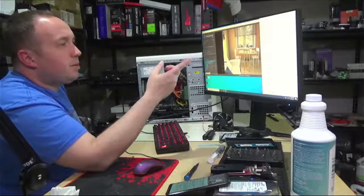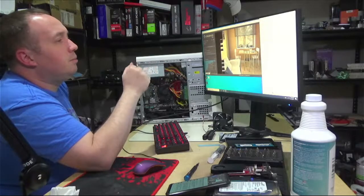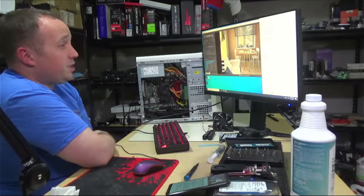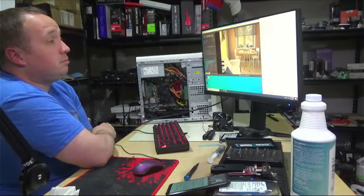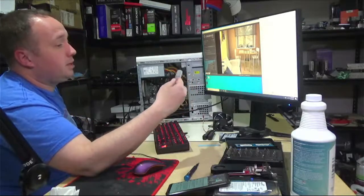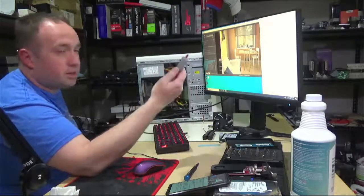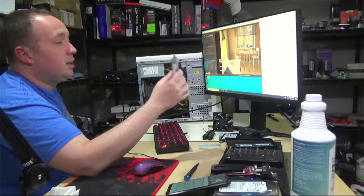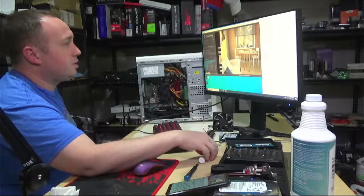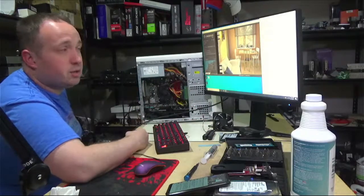So we're at a peak of 72 right now, so that's still 6 degrees below what we got to last time, unless it keeps rising. 6 degrees off max core temp is not anything to sneeze at, just from some cheap thermal paste, like this GD900 stuff from eBay. Since I repaste stuff constantly, CPUs, GPUs, you name it, this stuff is like $9 for this giant syringe. So I got 2 of them for 20 bucks shipped, and it works as good as anything else on the market.